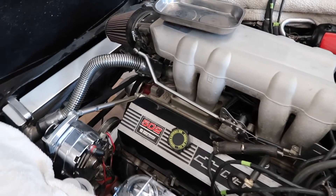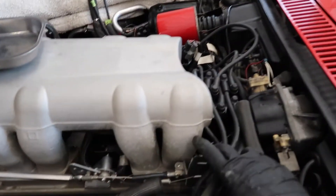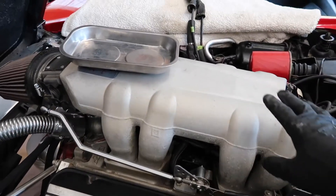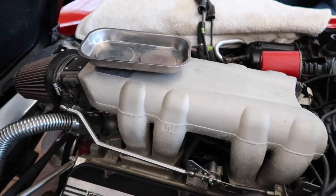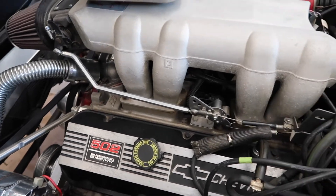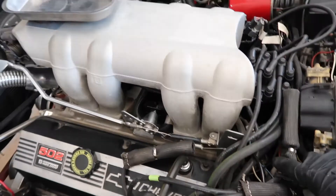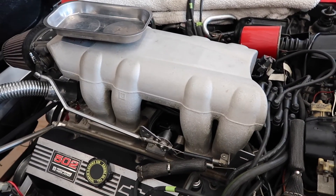The first thing I'm going to do is drain the coolant, pull the filter off, pull the plug wires, and disconnect the linkage. My main plan is to get this upper plenum off, which will give me access to the ECM underneath and all the wiring harness, plus better access to the back of the fuel lines I need to disconnect. Going to start tearing into this right now.